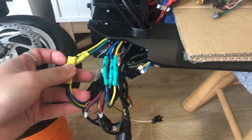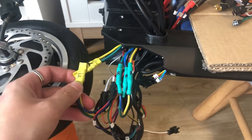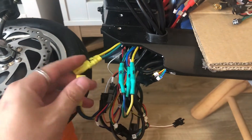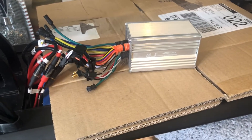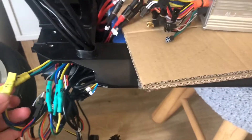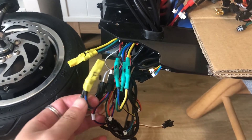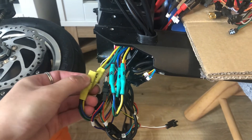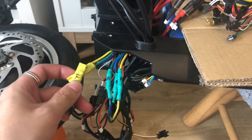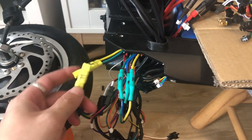As mentioned, if you need to run your scooter with dual motor drive, inactivate the faulty motor — in my case the front — and run it as a single motor scooter until you get your new controller. You won't be able to run it in single motor mode unless you unplug the motor that is shaking, so make sure to deactivate it as shown.